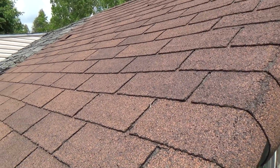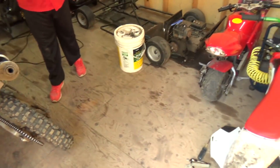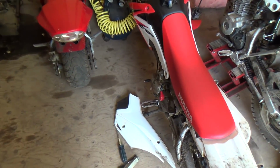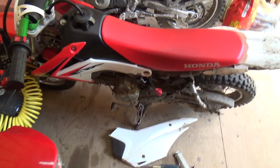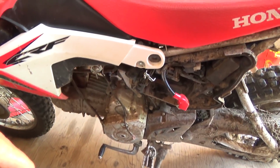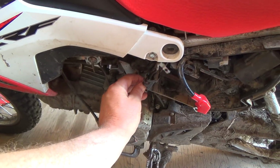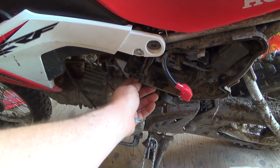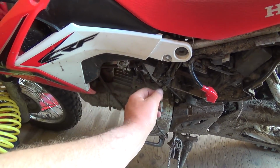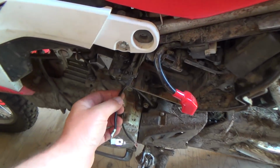Anyways, we'll get this battery installed and show you what else we found. All right, turn on a bit of light. Oh, it's hot in here too. So we had this thing going on that weekend when the battery was shot. Anyways, but we drove her. We found something interesting with the ground wire. It comes off the battery, comes down through here, across the other side, and it grounds out over on the other side somewhere there. There's a break in the wire right in here.